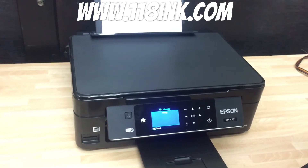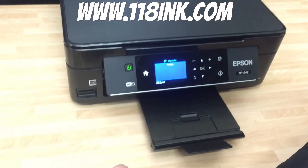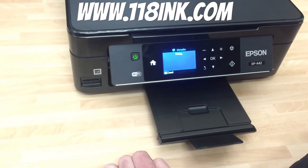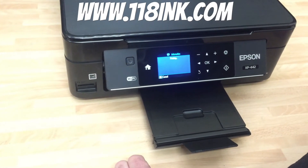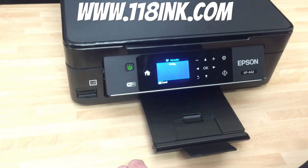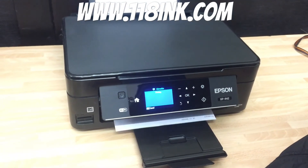What that's going to do is print in black, cyan, magenta, and yellow, so it's going to give us an idea which, if any, is the problem. That's just going to take a second — it's just priming itself. Printers can take a while to kick into action, so that should be done shortly.